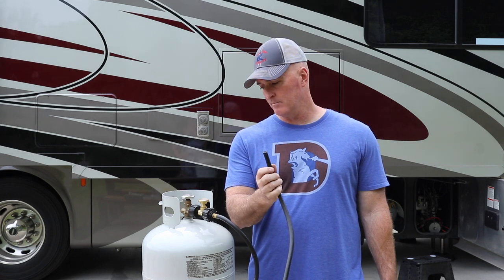Nothing's coming out. Quiet. Can't smell anything. The gas stop valve did exactly what it was supposed to do — 100% shut off a major leak. It completely shut off the gas. This is exactly why I want to add this to Ruby. With our front tire being real close to our propane system, I don't want to take any chances of a ruptured line causing propane to leak uncontrollably, which could cause a fire.